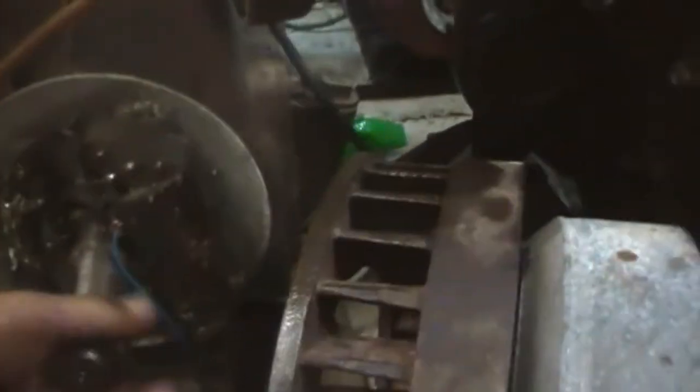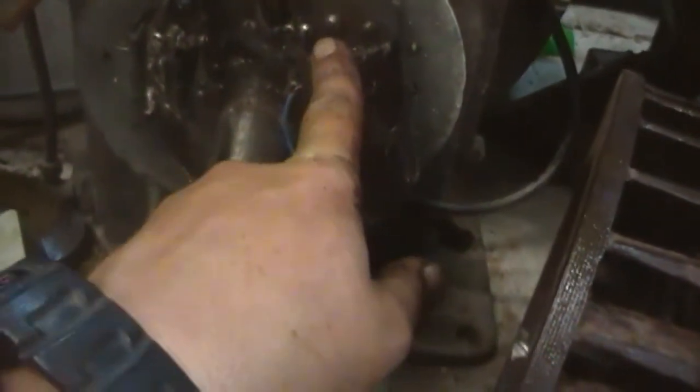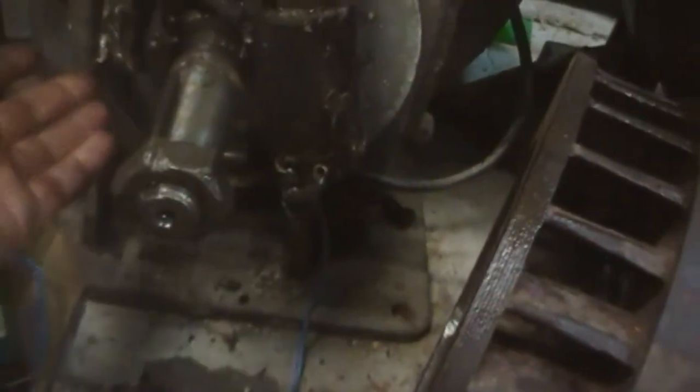It's the old crank-style megger I'm using — given to me, can't use it for work, but it's alright for the shed to test coils and stuff. So yeah, the coil's probably shorted on the points coil, or down to ground. And a little bit too high on the spark coil. I could be wrong — it could just be a little bit wet. I did burn it a little bit when I heated it up to get it off. But more than likely I reckon that's stuffed, and if not, the condenser would definitely be stuffed — they always are.